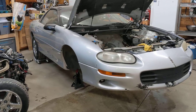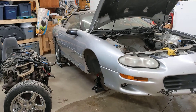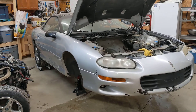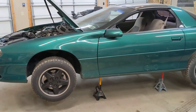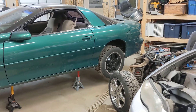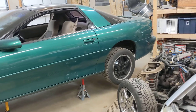That was apparently probably the easy part of this process, honestly. Next up I've got to get the rear end out — put this whole thing up on jack stands, take the rear end out of the silver car so I can get to the gas tank. My plan is to strip both cars bare: take the engine out first, then take the rear end out, because I need the rear end to pivot when taking the engine out. Then I'll take the gas tank out so we can swap gas tanks and fuel lines over.